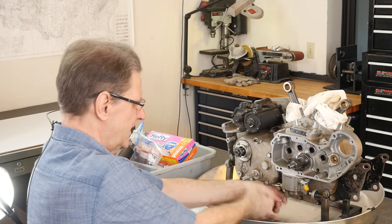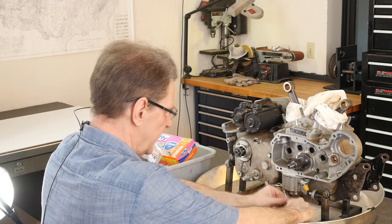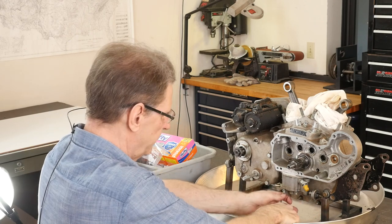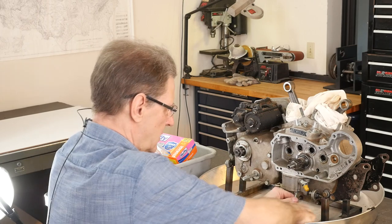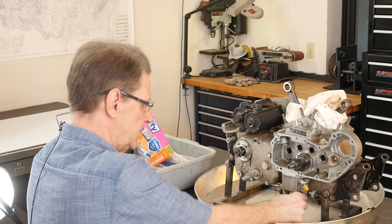Okay, I got bored, so I sped up the video four times speed. Because this is like a junkyard dog motor that's obviously put together from scraps and bits and loosely assembled, either there's dirt or something's making these four pump screws stick. They should just be finger tight. Once you crack them, they should come out. Usually they're nice and oily because they are oil pump bolts.